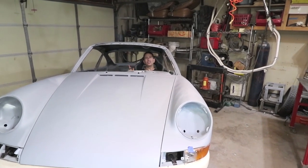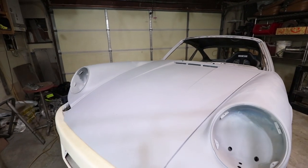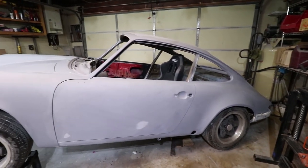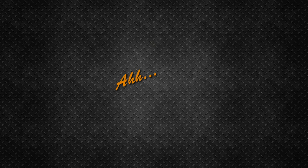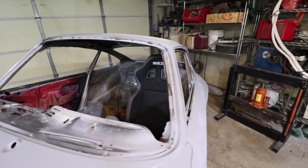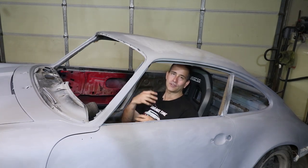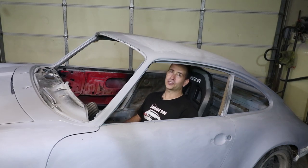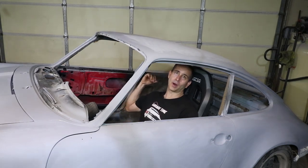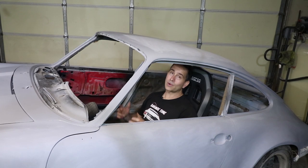Today, I want to fill you guys in on the remaining to-do list before I can get this car painted. Sometimes, the order in which I do things and the level to which they're completed is a little wacky. So now that the seats are in, that allows me to finish the roll bar because before I could mount the roll bar, I needed to establish the height of the harness bar that goes across the back. The other remaining items have to do with the interior as well. I'm trying to get all the welding done, and that means doing the seat mounts for the passenger side.